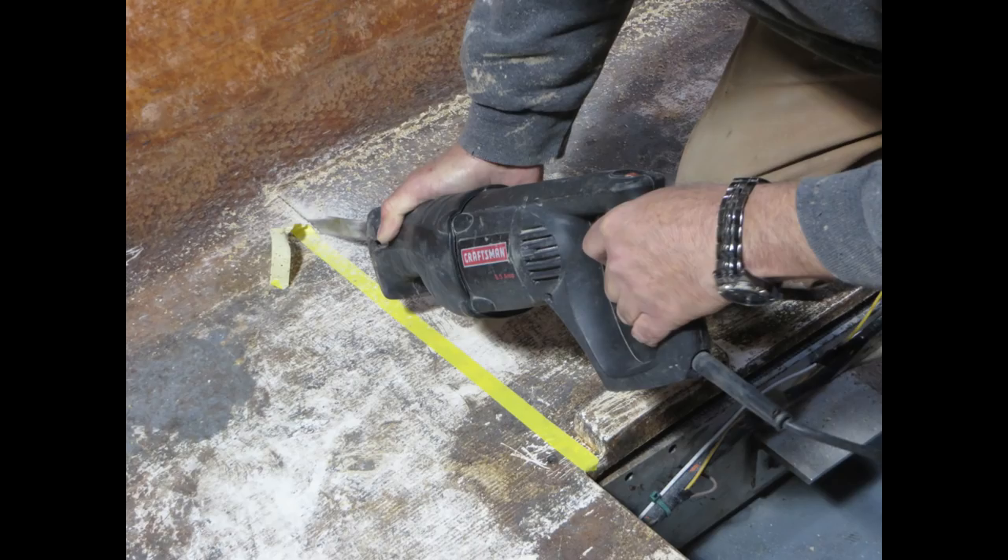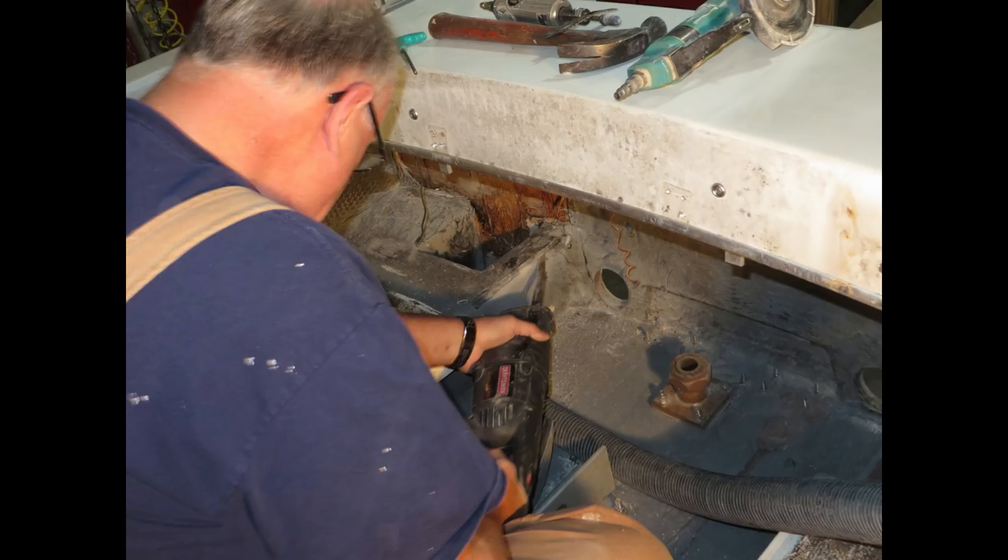When you're cutting across the floor and across where the stringers are, you'll plunge the blade into the floor cavity cutting into the foam, but when you hit the stringer area you want to float your blade over the top of the stringers. You don't want to cut the stringers. Making sure all of the screws have been removed in this floor section, you can then cut across the top of the stringer below the floor in between the two, splitting it apart.